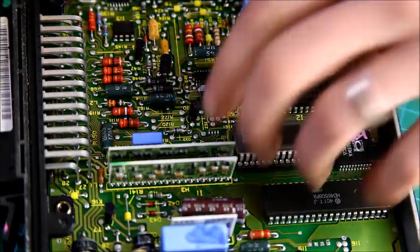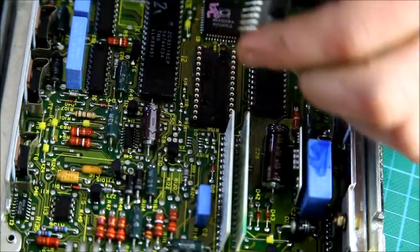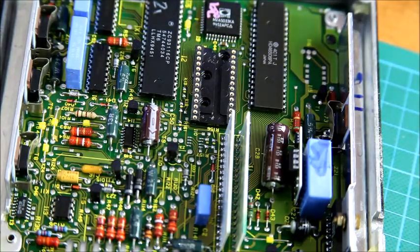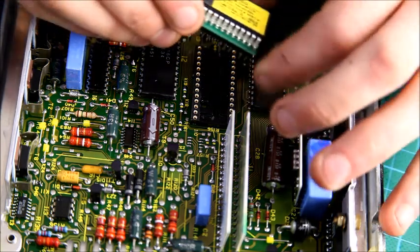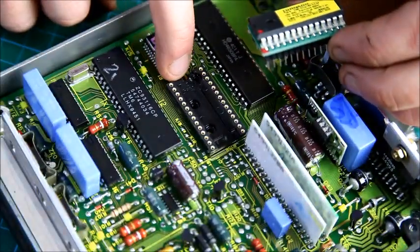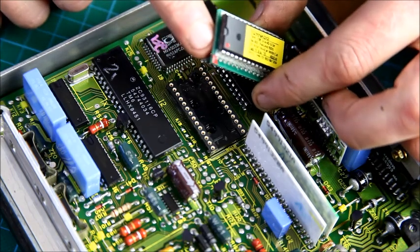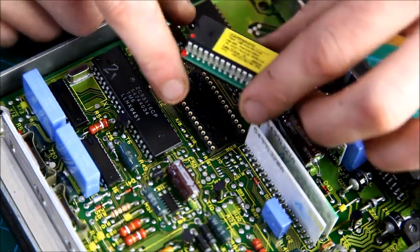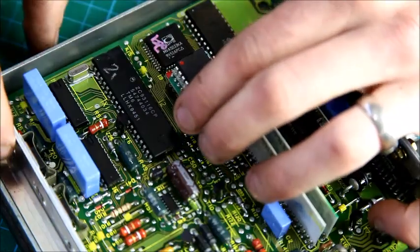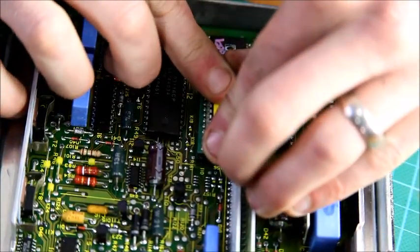You can get chip pullers or removing tools, but DIY people often haven't got them and there's absolutely nothing wrong with removing the ECU chip this way as long as you're careful. The new ECU chip comes as a twin assembly — the ECU chip on top, and all the information is encoded so it needs to run through this decoder board first. There's a small half-moon cutout on the socket that denotes pin one, and you can see that half-moon cutout on the ECU chip as well. The decoder board doesn't have that, which is why we paint the corner where pin one is with red paint. Place the chip in position, double check all the pins are lined up, then push it down nice and squarely.